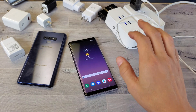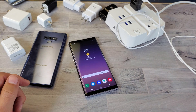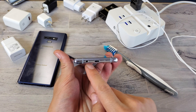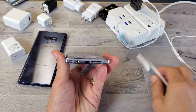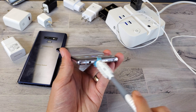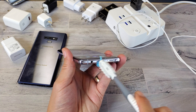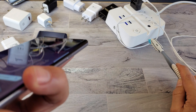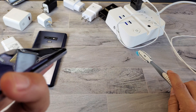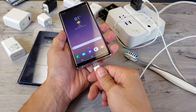If your hardware seems correct and you're still having issues, try cleaning the charging port. Grab a toothbrush — it's possible you have lint, dirt, or debris stuck in there. Just go in and give it a little clean, then blow it out and clean it again. Note that if anything happens to your phone, I'm not responsible for it. Then grab your cable, pop it in, and see if you get fast charging.